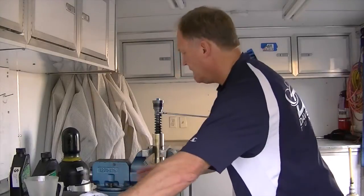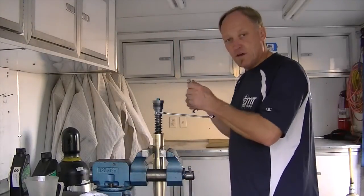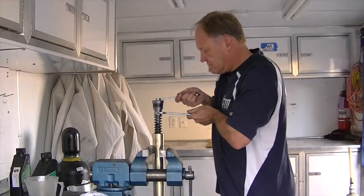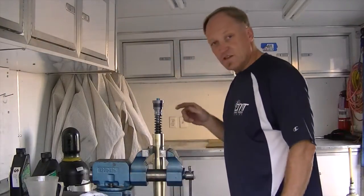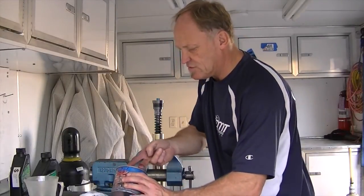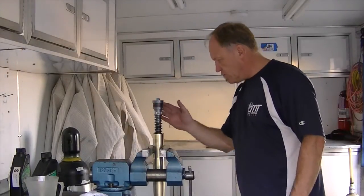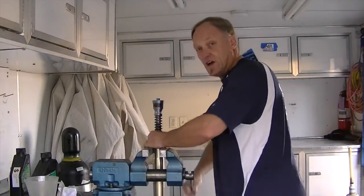On aftermarket caps like this, generally you don't have to mess with the hydraulic adjusters. Snug that up — the fork is now reassembled and bled. One last thing that's very important and makes things really easy later: put a little bit of grease on the threads, which also helps the upper o-ring stay lubricated.